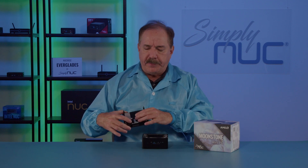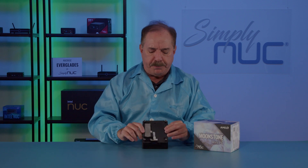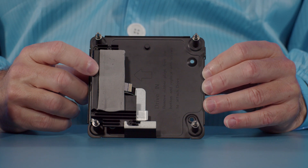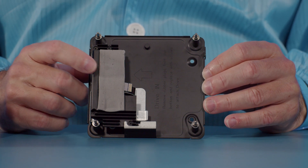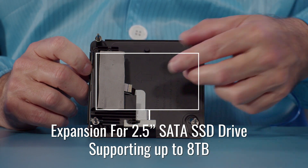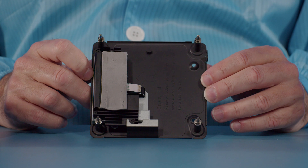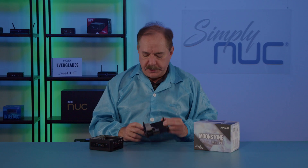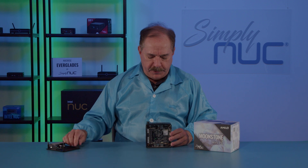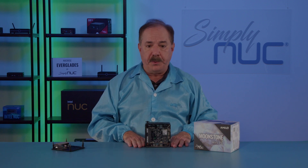The bottom drive cable has been removed. This is a prototype unit, but I do want to show the bottom plate. This is the 2280 SSD cooling. The two and a half inch drive bolts in here and the ribbon cable is normally plugged into the motherboard — so it's very easy to add your 2.5 inch drive and good cooling for your 2280 SSD.